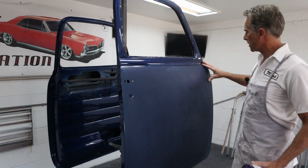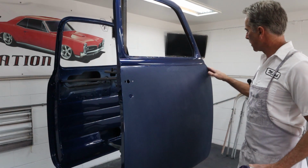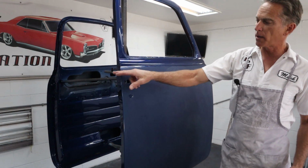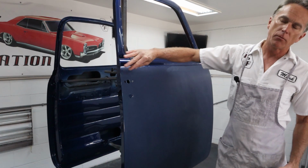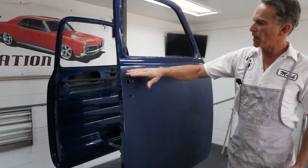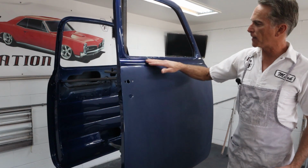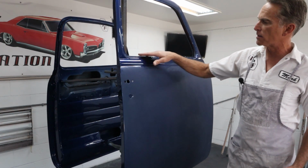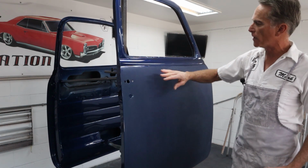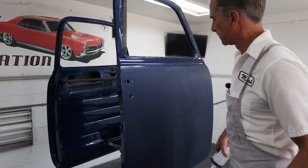And so I'm gonna work my way across here, and of course, the wheel does not reverse. So it's easy to polish on this side because the wheel will be going off the edge, but on this side, the wheel is gonna try to cut in on this edge. So we have to kind of flip upside down and polish this edge away. Other than that, it should be fairly simple, and you'll see me bump the polisher up over this edge. I'm not trying to get in up here too high because this will cut my wheel, but I want to get in down in that groove, and you'll see me turn on edge and get in the groove and then just kind of bump over the whole thing and get it polished. So let's get some polish on this thing, get it going.